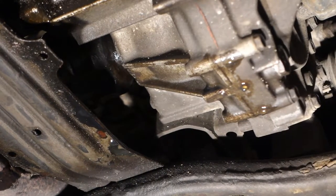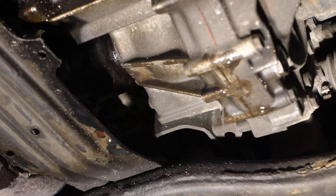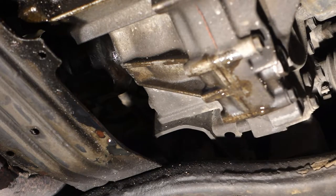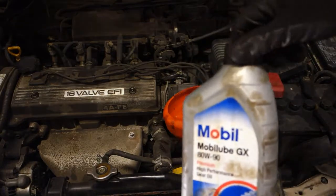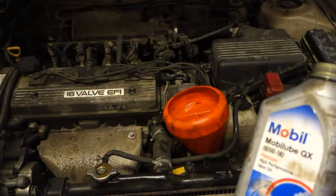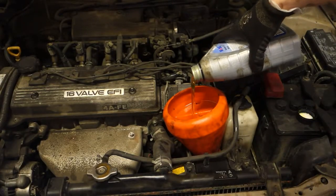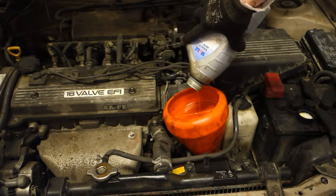Okay, and by the way, our gearbox oil is dropping, and that oil is in my canister, but I recommend that we add new oil in this gearbox area, because almost all the gearbox oil is now drained out. Okay, and in that step it's good to add more gearbox oil, because when we took out this drive shaft, almost all the gearbox oil went out.